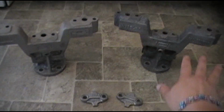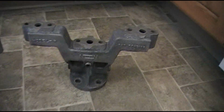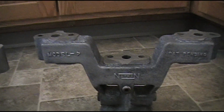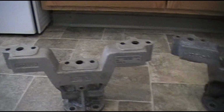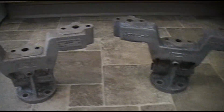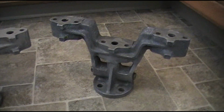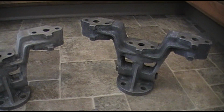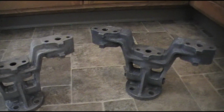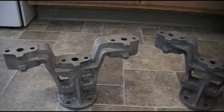So the first manifold that the P-horns had was what the collectors call the gull-wing manifold. And this has a setup where you have two horns on each side of these wings, and one horn in the center. And you can see with the newer one, that's the same way. Now, you have the old cast and new cast versions of these gull-wing manifolds. However, very big emphasis here, the manifold does not produce the sound, the manifold does not change the sound. It is very common to have an old cast manifold that has new cast bells on it. It's still a new cast horn, okay?